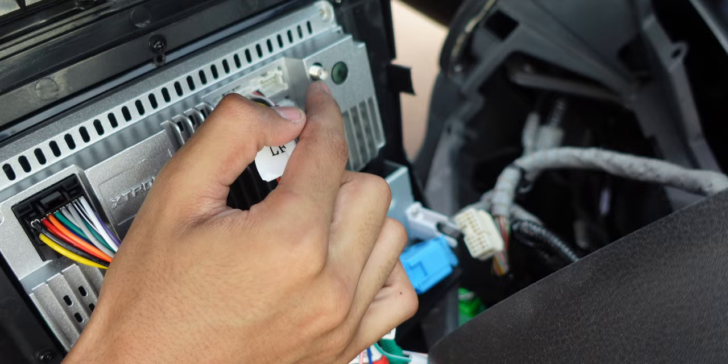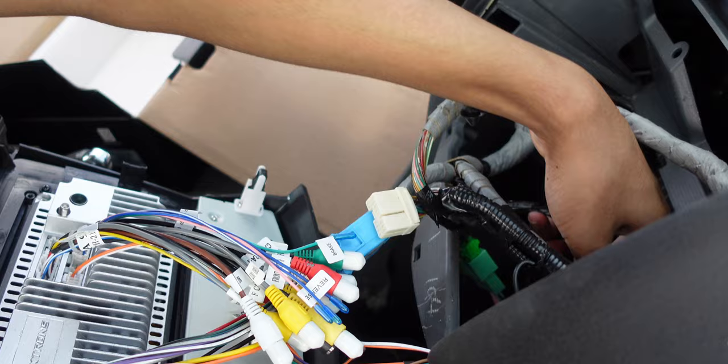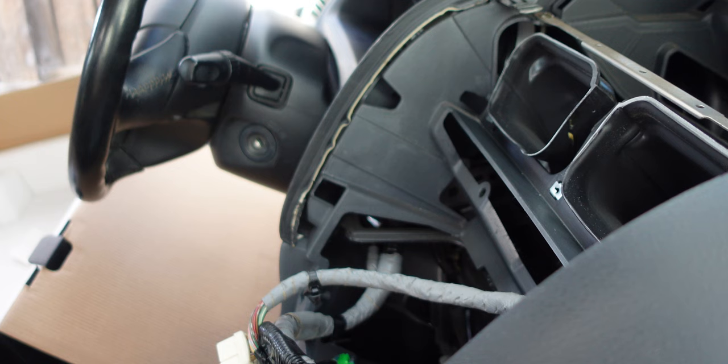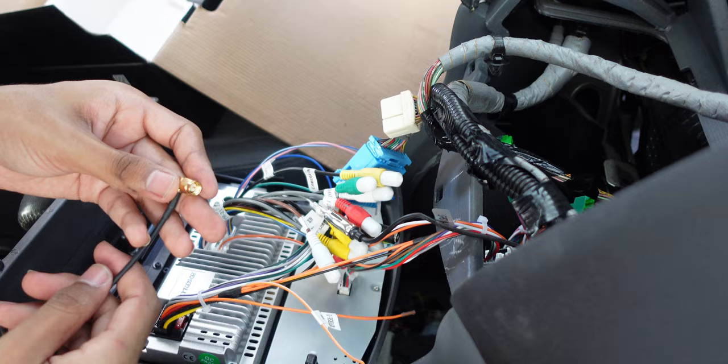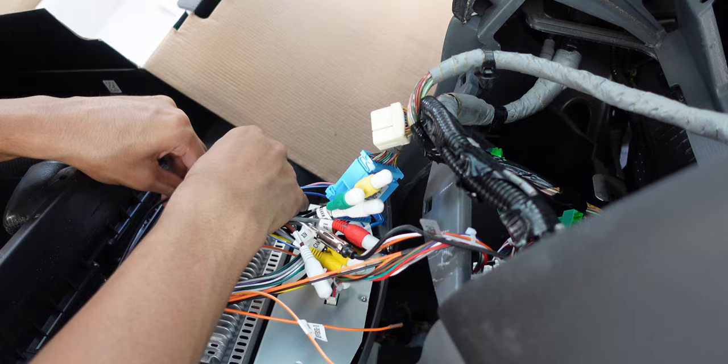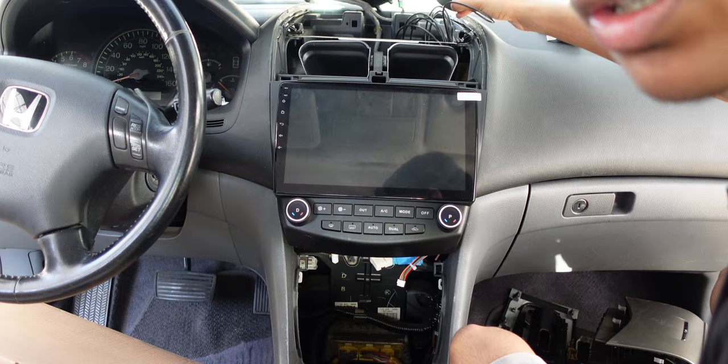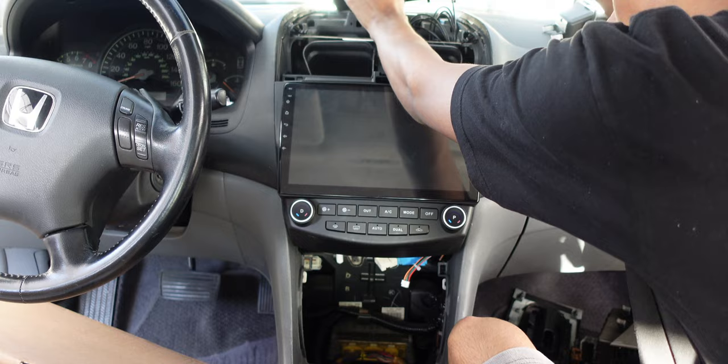Everything is connected properly on the new unit as shown earlier. Now just connect the GPS and the antenna. The white connector you can leave out — the blue one is all you need. For the GPS, place it on top of the plastic dash piece since metal interferes with the transmitter. Fix it in place and tighten with the hex screw. For the antenna, it uses 3M adhesive — peel it off and stick it on the back of the trim piece.